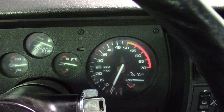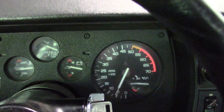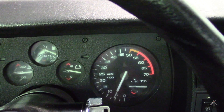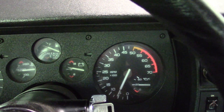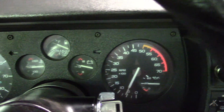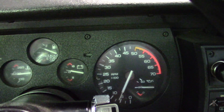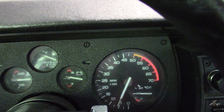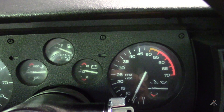On this car I've had a few times where the idle was high. One was with my scan tool plugged in — it was definitely high and I ran a separate video on that. The other cause is vacuum leaks, and I've had a number of times where a vacuum hose was off, particularly on the purge system — if the purge canister isn't working right it will affect the idle considerably. I'm almost up to 220 degrees, which means the fan will be kicking in shortly. I think that's all for now — I'm going to shut her down and call this one a wrap.